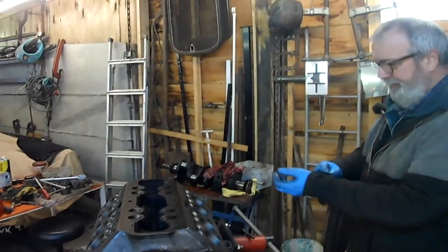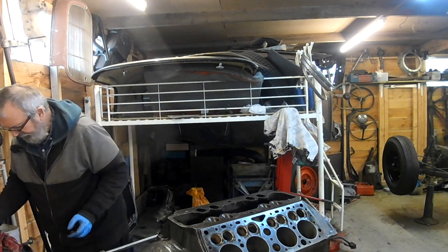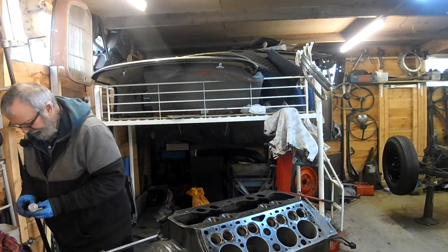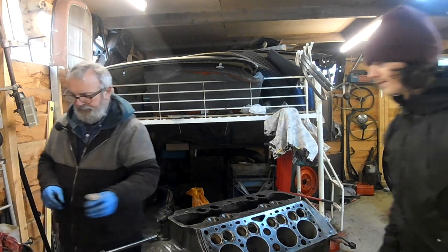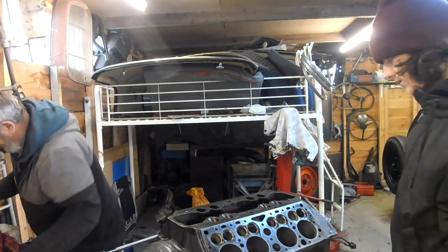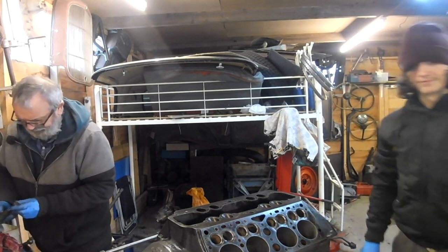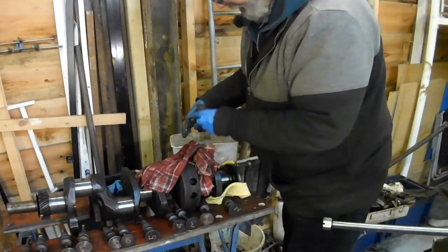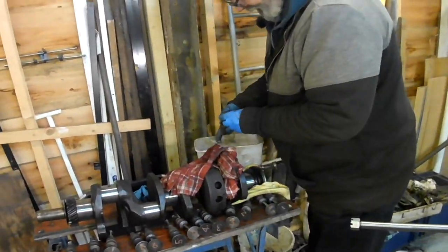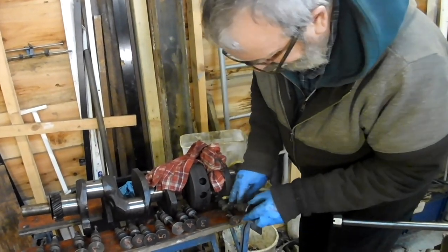Okay, valves then. This is cylinder number one, and all the valves are in here. Now what we have to do, we have to put the springs on and stuff. Okay, and I'll show you a trick. So here's the valves, look, Jack. See, that's number 8 with a dot. And that's number 8 without a dot. Swing the camera around over here, Jack. There's number 7 with a dot. Five with a dot. Two with a dot. Okay.